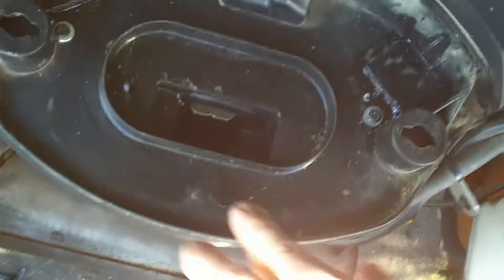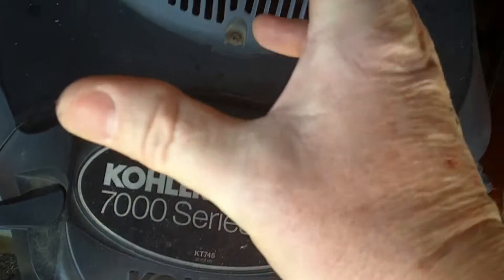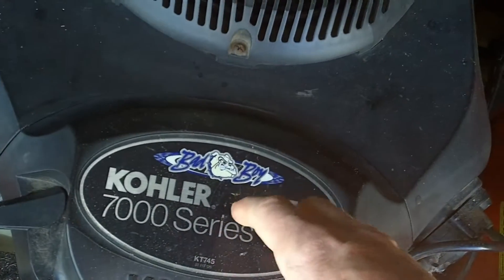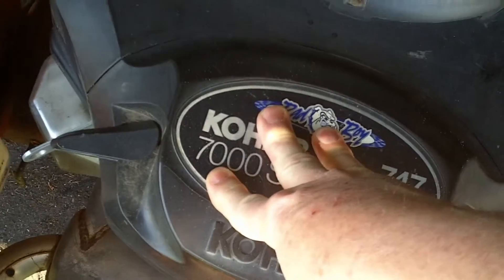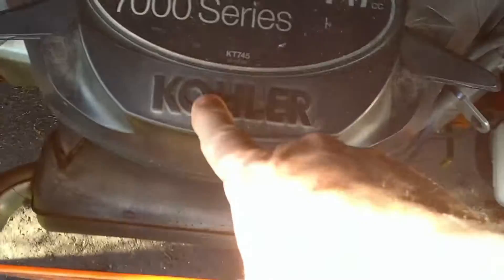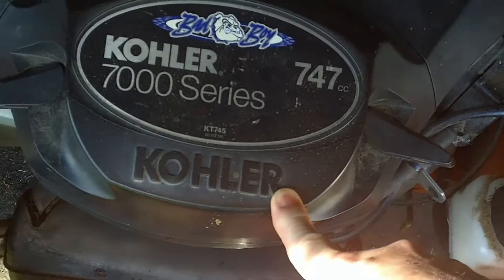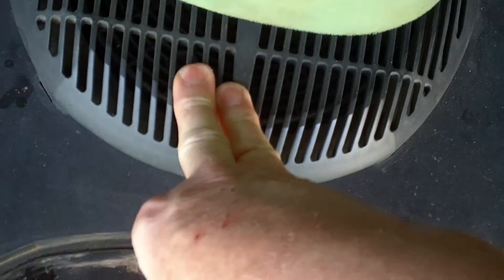What I'm trying to do is make this whole thing airtight. I'm going to mount a proper air filter system off this box so it's going to breathe through three or four filters. This thing gets an awful amount of dust in there, and I don't want to be replacing motors — that's why I'm modifying it to make it live longer. Right now I'm isolating this airbox away from the dust-catcher area, and that's all this is.